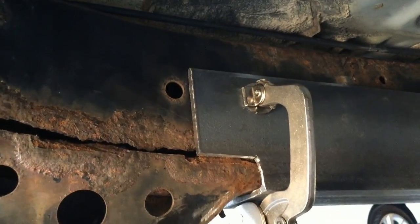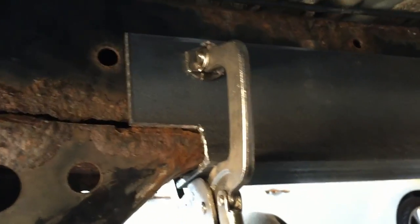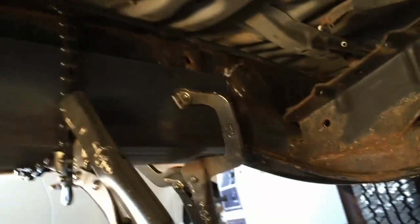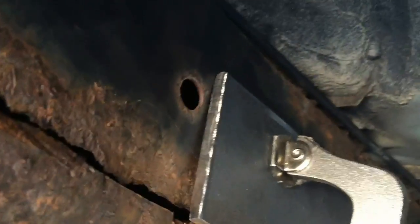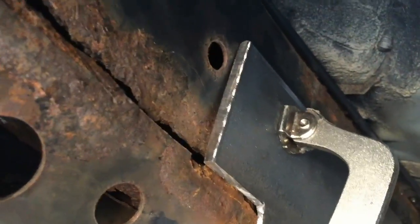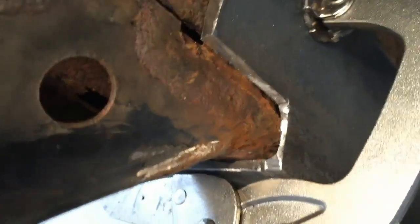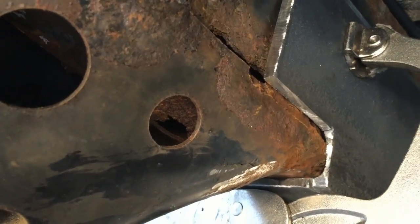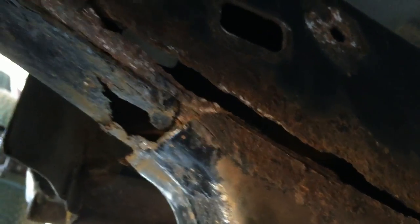After the modification — I cut out another chunk and did quite a bit of grinding in that corner to make sure the piece fits in there fairly well. Since it's quarter-inch steel I'm not worried about taking some off, and this will be a pretty good compromise. I have this thing strapped in pretty tight now and I'm feeling good about it. The important thing is that this bracket is centered well relative to where it was before it broke, because it's going to dictate the squareness of the rear axle.